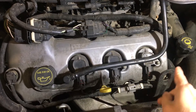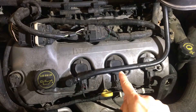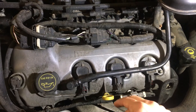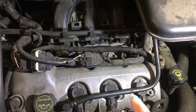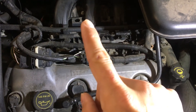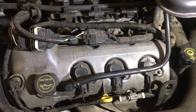The other thing I wanted to mention: this was a P0355 code for ignition coil E. I think it starts at P0351, then 352, 353, 354, 355, and 356 depending on which circuit it is — A, B, C, D, E, or F. I think they're lettered the same way they're numbered, so cylinder one is probably A, B, C, D, E, F.